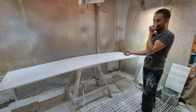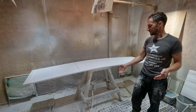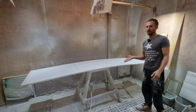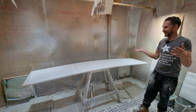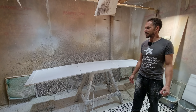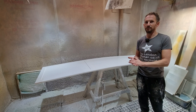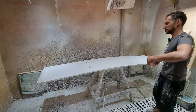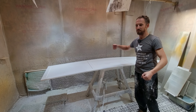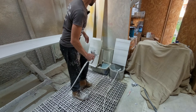So that is it — it's as simple as that. When this is dry it's going to get a hit with P240 to sand it back, make it nice and smooth, and then it's simply going to get another two coats, exactly the way I've just done it, same methods, same paint, nothing changes. It's all about the speed of your gun, how you move, the height. You get the feel after you've been doing it for a few years — it gets easy with the gun. You've just got to flow and do a lot of practising. You'll know how far your gun's got to be away from the work and how fast you've got to move, because it's so easy to get a pull.